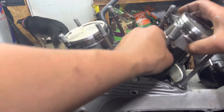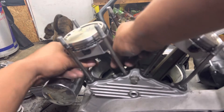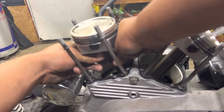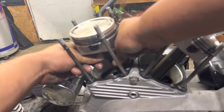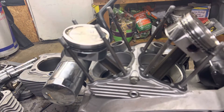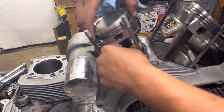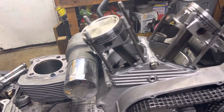The rear — the outer rod — is actually in much better shape. Rechecking the front inner rod: a little bit of play left and right, not much up and down. So the crank is good enough, it'll run. It shouldn't make too much clattery noise. I'd like it a little bit tighter if it was a brand new performance build, but for what it is — a Stocker 1200, a little more performance-oriented than a stock 883 — nothing stands out. It's not catastrophically loose at all, just a little bearing wear, but we're going to ship it.